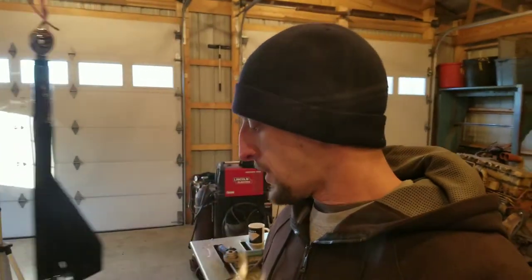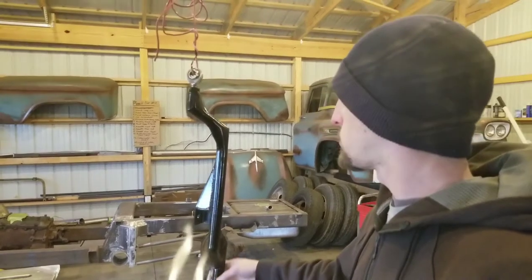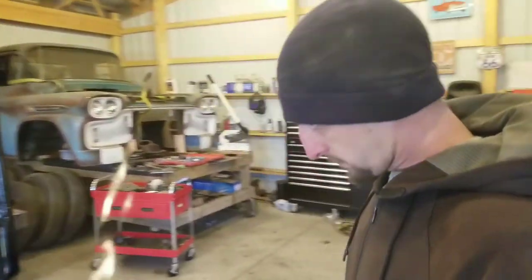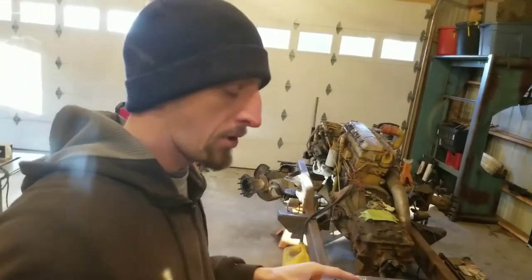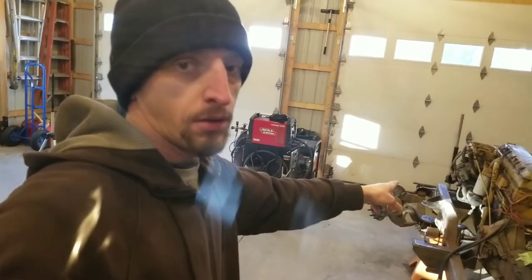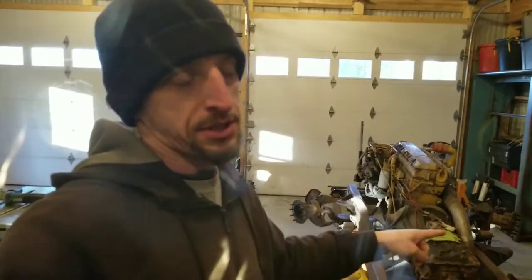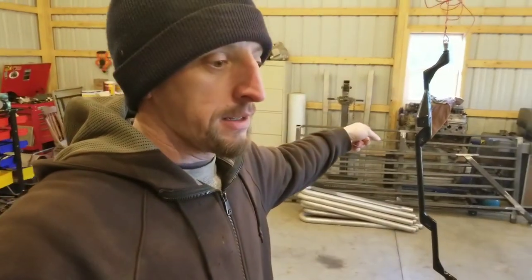That's my quick tip. Now that the shop has cleaned up a little bit, I'll go ahead and pull down the center link and do an install — it's two simple bolts so it won't take much time. I'll give you guys a closer look at how this is going to work. Once that's in, we'll be able to scratch it off the punch list and move on to number three, which is the bump stops for the front and rear. I don't think I'll do the fronts until after I pull the motor and trans out, but before that I have to fab in the exhaust and the drive shaft. So we'll handle the front bump stops later and focus on the rears.